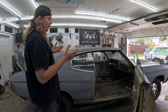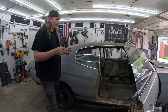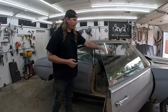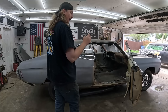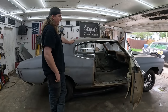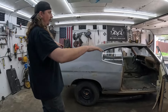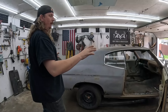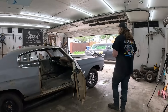We may end up cutting the floor apart and re-welding it on the car. On tri-fives I've always welded on the rockers first — that way the body is secure — then weld another bar across and cantilever the thing up to jam the floor in. The other option is to pull the frame right out, build a little A-frame jig for the front, engine crane the back, slide the floor out, clean it all up, POR-15 it, and put it back. Probably an extra day or two, but time and money well spent.